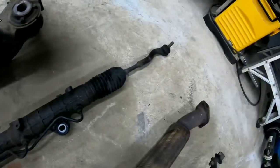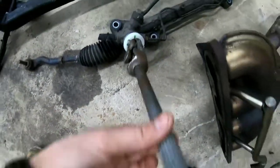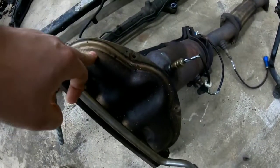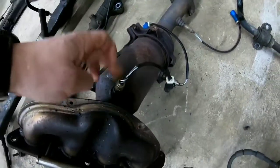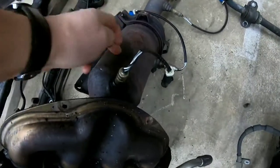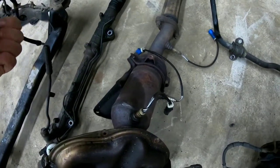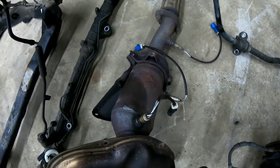This is what steers your wheels. These rods go in and out, and it's connected to your steering wheel and also to a power steering. Here we have the catalytic converter and the exhaust manifold — this one is connected together but usually they're separate. This is your catalytic converter, and you have your oxygen sensors — three of them here. And then your flex pipe. We are going to be doing a video later on about catalytic converters, comparing aftermarket versus original versions and also diesel DPF systems.